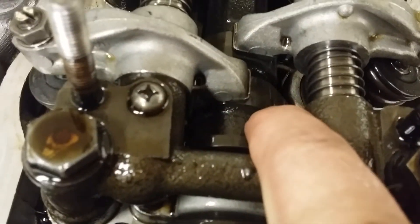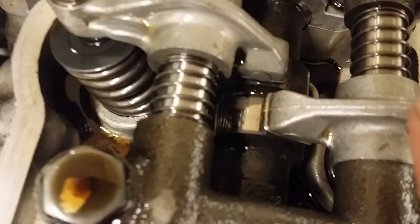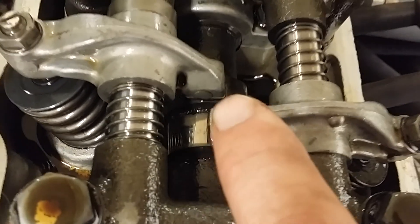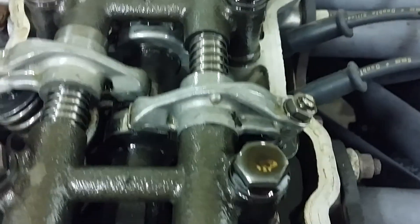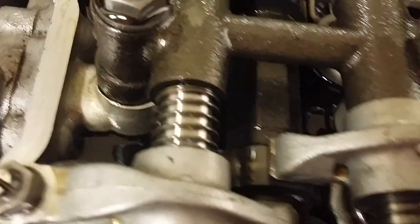Going back to what I was saying — there is a sequence to do it, but basically what you're looking for is the rocker arm riding on the cam down in there. You can see the lobe circles — there's a good one, you can see it's a little bit shiny. That's where the rocker arm is touching the cam. It's riding right on top of the cam, and when the lobe comes up, it rocks it — that's why it's called a rocker. It rocks and pushes this tip down on the valve, which pushes your valve down. So when you're adjusting them, you want your rocker on the part of the cam that is not the lobe.